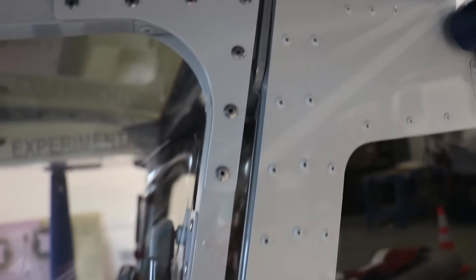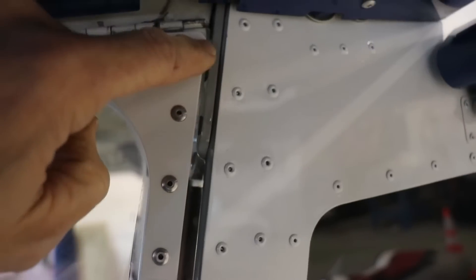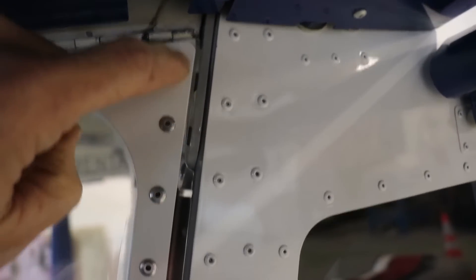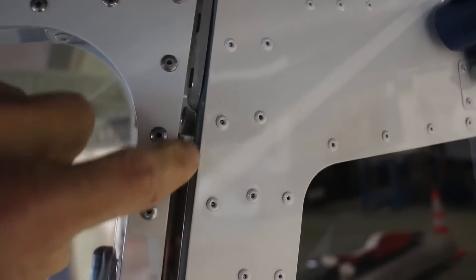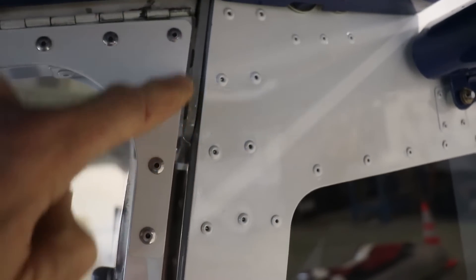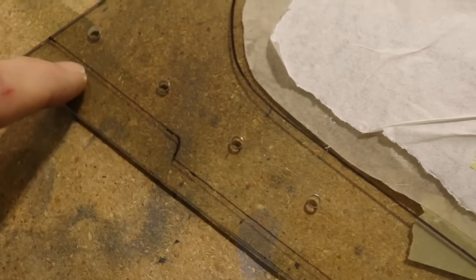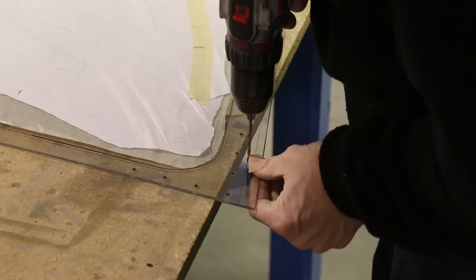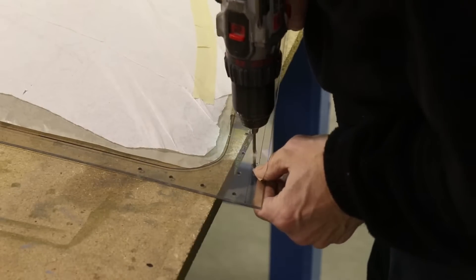I can show you what I mean by looking at the cruiser here. This big gray piece is the aft wing strut attach point, and you can see right where the glass is cut — it goes all the way back and is cut out around there. The first thing I'm going to do is drill a hole right here so that when I cut this out there's a round edge, not a 90-degree corner.